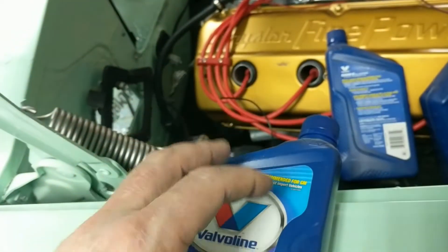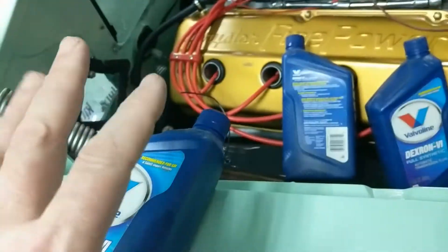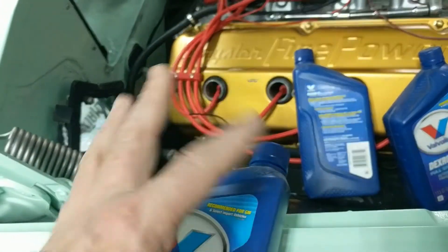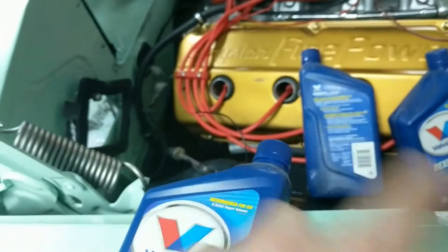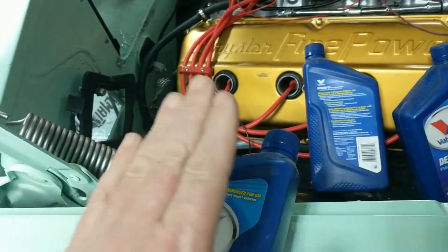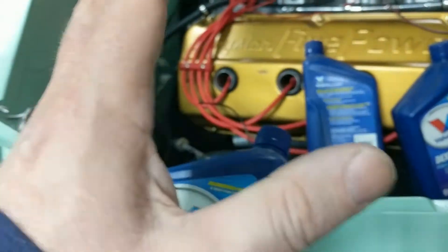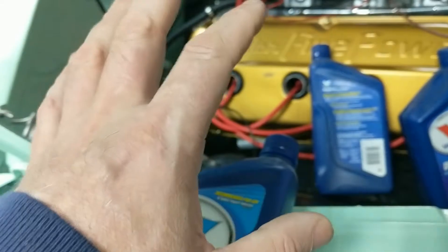But the majority of them were always backward compatible to Type A's up to like... even confirmed up to like '76. All Chrysler ATF - the dealer can that says Chrysler ATF, plus, or plus something, three - it's all backward compatible to Type A up to that point. I can't really verify it's 100% since then. You've got to understand these things just start talking about VVTs and all that.